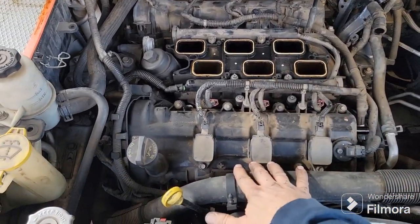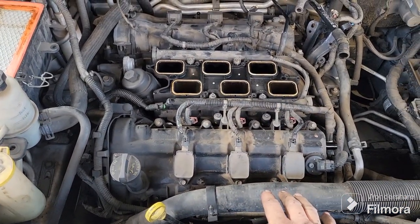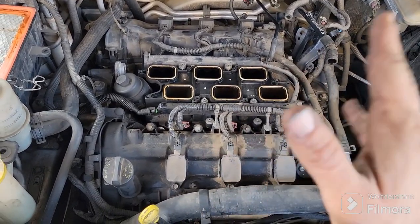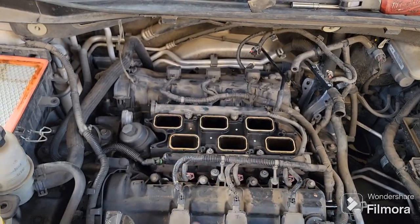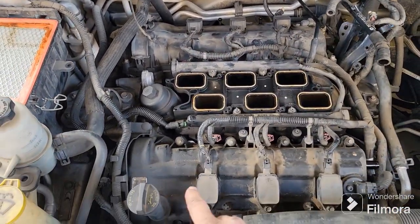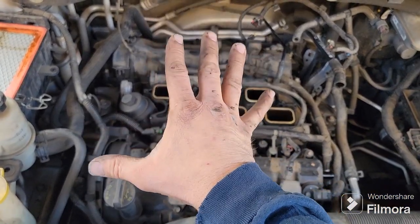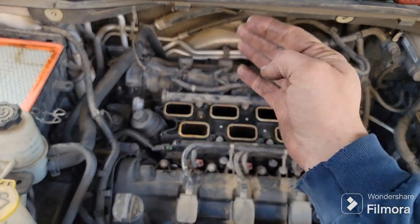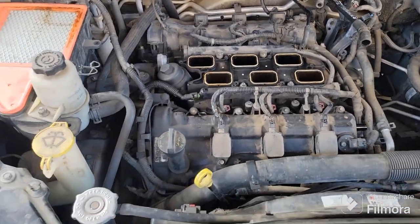We're going to take off the valve covers, and we're going to inspect the camshafts and see if it's a cam problem. I also did compression on cylinder 1 over there, and it was good. This one's number 1. It's 135-246. So I did it on number 1. It was good. So compression good, spark plug good. I re-swapped coils again at that time, and it's still number 1.